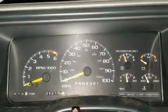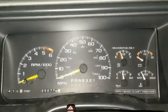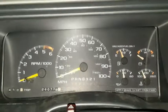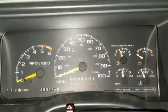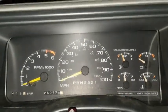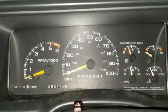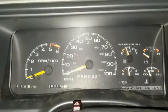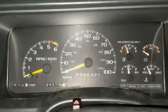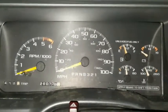I'm making this video for anyone with GM trucks from '96 to '99 or even later experiencing the same issue. What's happening is sometimes my engine cuts off and won't allow me to restart, giving me a passcode error or crankshaft sensor failure — multiple electronic fault codes. I originally thought it might be my ignition switch. Basically, whenever I use my turn signals, my voltage drops from 14 down to about 12, and sometimes while driving it just shuts off.